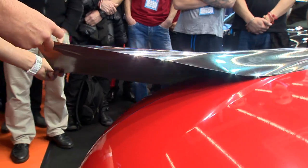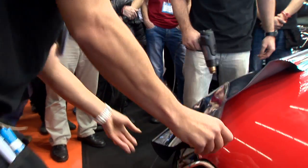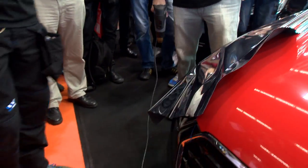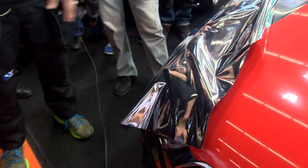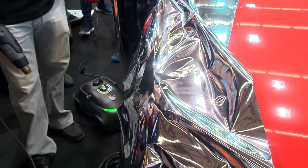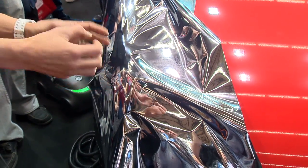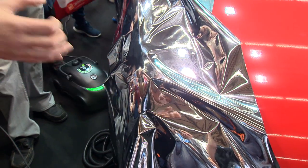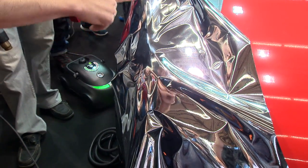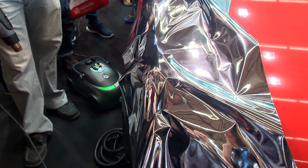First time, I'm going to use what I call triangles, where we're really trying to make the tension really minimal at the front. When you're wrapping, if you look at the material, it tells you how it wants to go down. If you look at it from this angle here it's really flat. It's what I call glass, right here. But when you get to the front, the material starts to buckle. That tells you where the tension is, okay? So for me, John and I are looking here. He's going to heat it here, and I'm going to pull in the shape of what's called a triangle, and I'll talk about that more in the demo tomorrow.